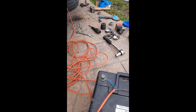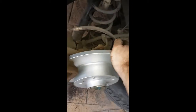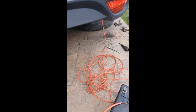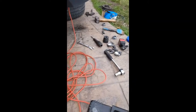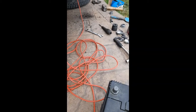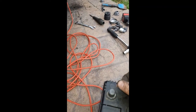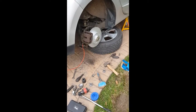I can hear them advancing, got the birds singing, bringing them back in. Do you hear it change tune? That means the brakes are on. Now we shouldn't be able to turn the rotor because the handbrake is on — and we can't. That's a relief. So now we need to back them off the same amount as the car would. Remember, when the car wakes up from its operation and you put the battery back on, it's going to think the brakes are off because that's how it was. So here we go — positive to the back one, positive blue this time, and back it off. That should be off now. That should be all we have to do with the parking braking system. So now when the car wakes up from its dreams, hopefully it'll think everything's just fine.